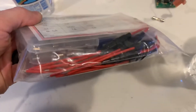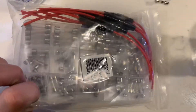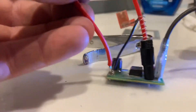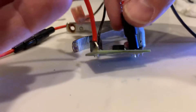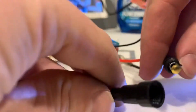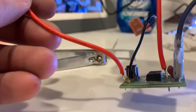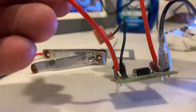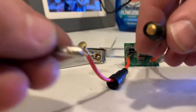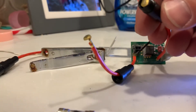Here I got this kit on Amazon — I'll leave a link in the description. This is all you need: it's got wires with screw caps so you can replace the fuse without having to do any soldering again. I did a quick solder right onto the connections here. I just soldered two ends onto it, and right here is where you put the new fuse. You shove the fuse in, screw it together, and it's good to go. If you ever blow the fuse again, all you have to do is put a new fuse in this spot.